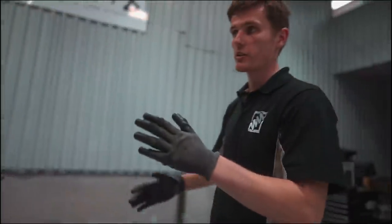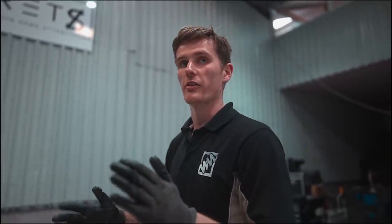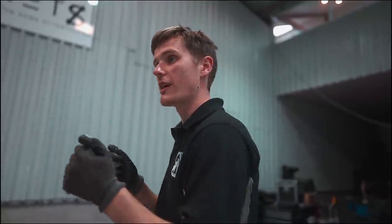Set now, so we've got the rear toeing in to our settings. Before it was neutral on one side and toeing out on the other, so that's going to really upset the back end, not feel nice at all. On throttle, it's going to try and twist and crab a little bit, whereas now it's going to stay true and straight, still allow rotation but not oversteer. Nice. So it'd be a lot more nimble.